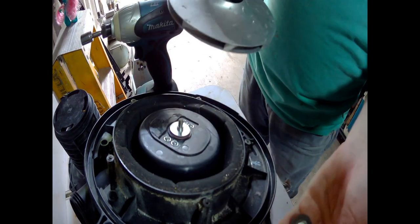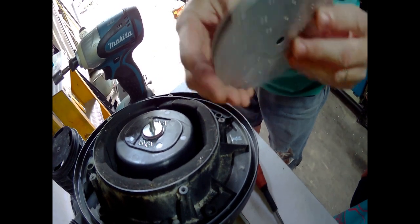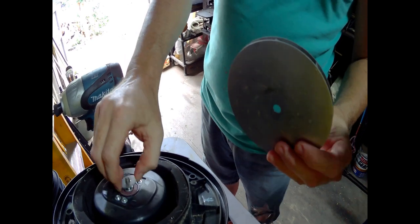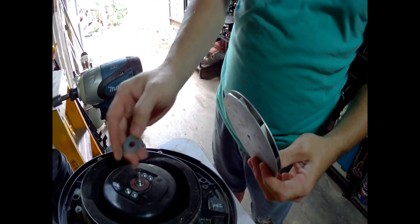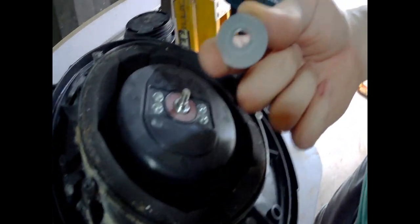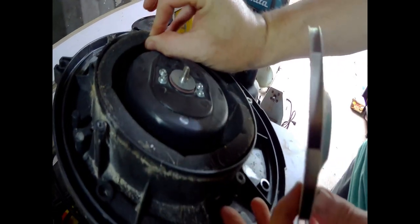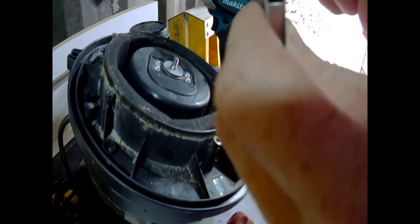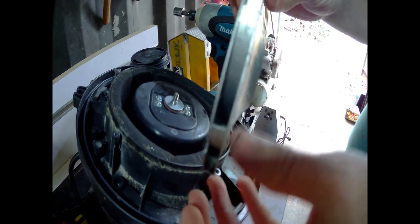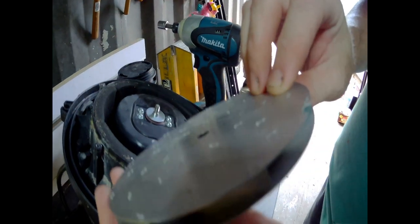Remove this and take out your washer. Take this flywheel out and clean it — it's already clean because I've done it already. You want to blow it out with air. You don't need to remove all these washers, but if you're going to turn it upside down, take the washer off so you won't lose it. If you've got stuff packed in there, you may have to stick a wire in to get it loose, then use an air compressor on it.